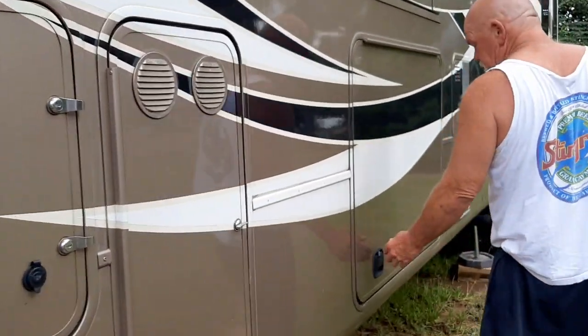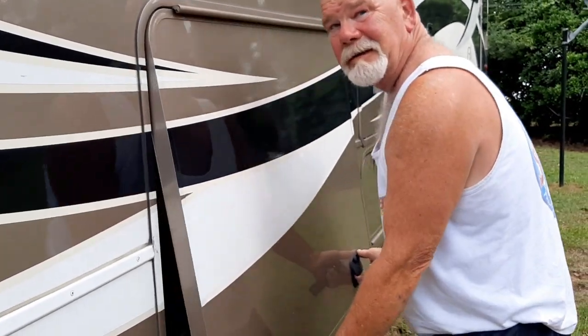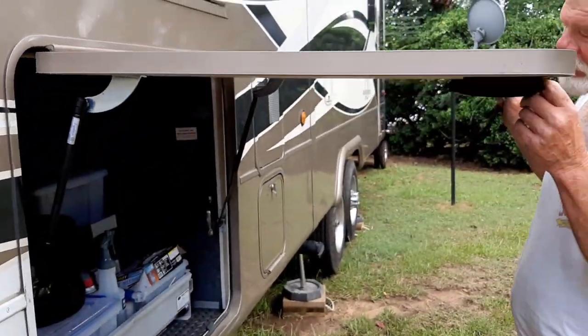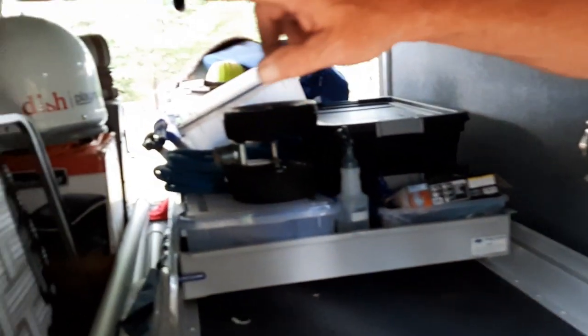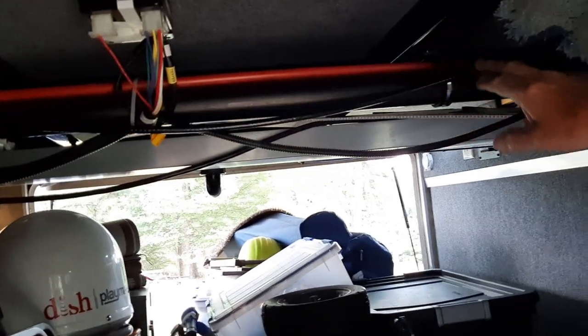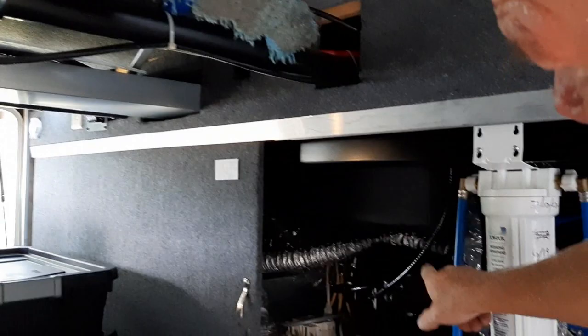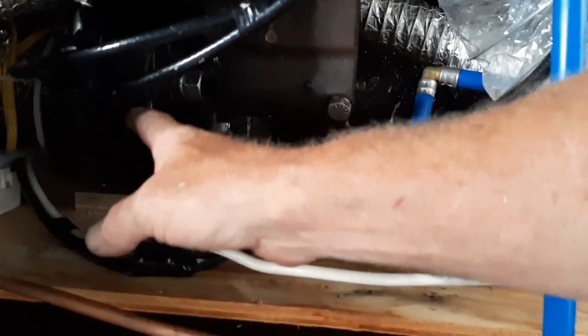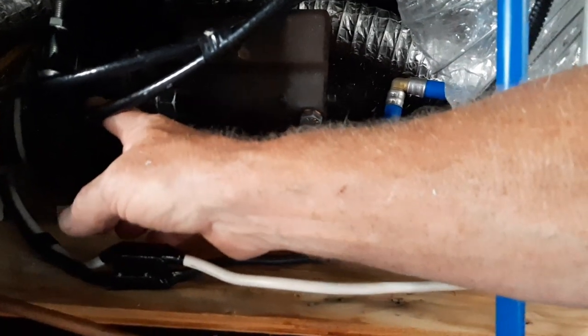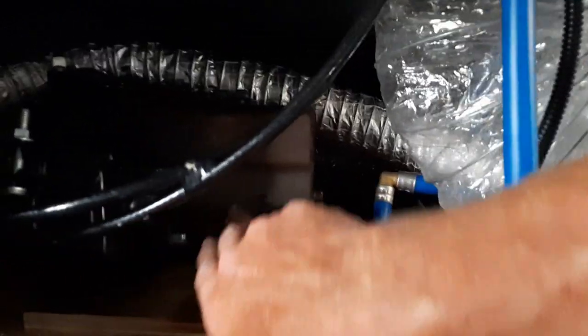Was that difficult putting all that together? Incredibly easy. How long did the whole thing take? Two days just because of the location — I had to drive out there and didn't have all my tools. I ran an airline from the valve and the tank all the way back into the basement area, behind the gray doors. And here sits the brake can, the air can for the brakes — it's basically a big diaphragm with a steel rod. You step on the brakes, it drives the steel rod into the master cylinder and applies the brakes, pushes the brake fluid in.